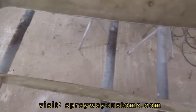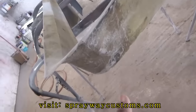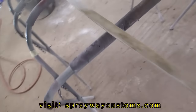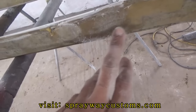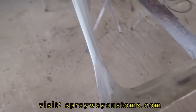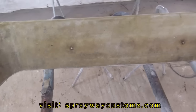Before I install the third brake light, I got this trim piece here. I'm finna wrap it, but I had to repair it. It was cracked in three spots. Right here, you can see how I fiberglassed it. It's fiberglass itself, so fiberglass worked well with it. I fiberglassed this area here too. I put some filler on the front side just to kind of smooth it off. Also over here, this is only on the LS Brougham box shapes.